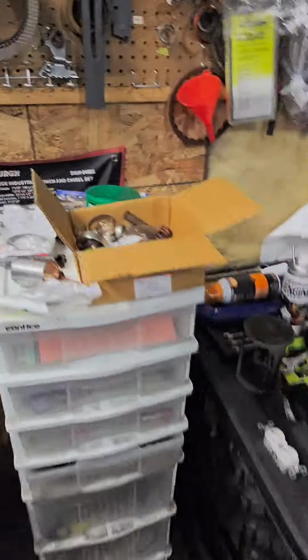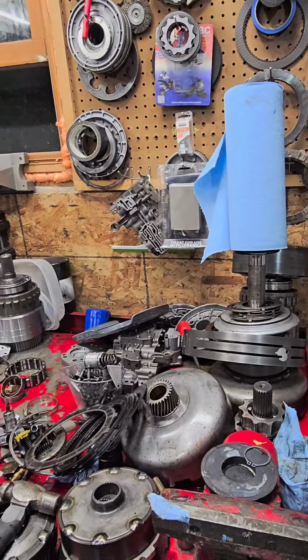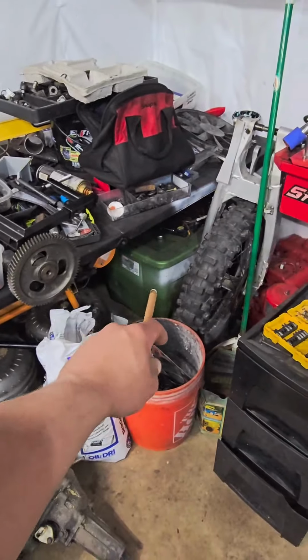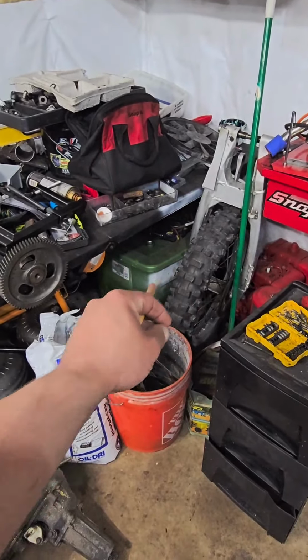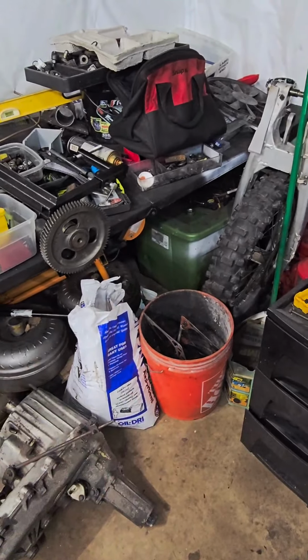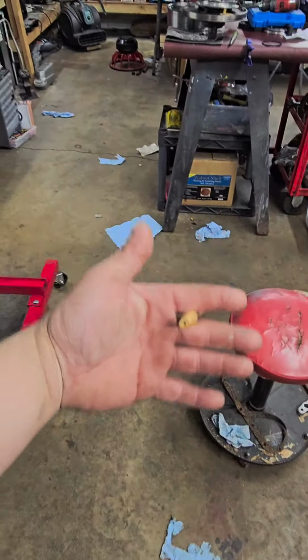Those are a couple more good ones I got. I got some billet gears here somewhere too, but they're junk bullshit. I got a whole bin of 48RE pumps that have been ruined by billet pump gears. There's at least 10 or 15 pumps in there that I thought I was giving my customers a good upgrade by giving them billet pump gears.